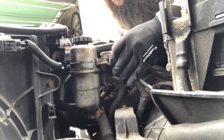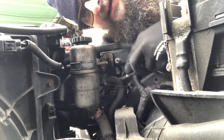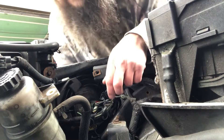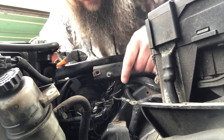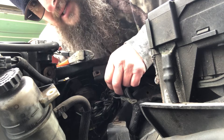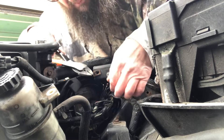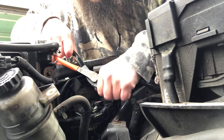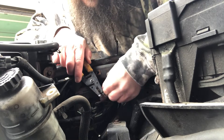Let's take this off. Sometimes you can get away with just cleaning the connection, but it's not going to work this time because the corrosion is in the wires themselves. I chopped them off and had to move my power steering pump out of the way. I've got five wires — one's probably the turn signal. I'm not sure what they all are. I cut one and stripped it, and I still don't really like that metal but I'm going to reuse it. I'm going to strip a couple more of these.